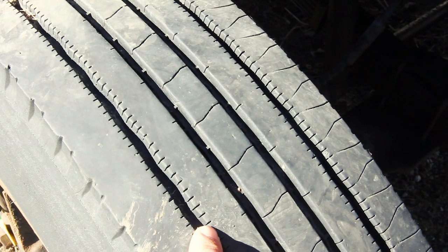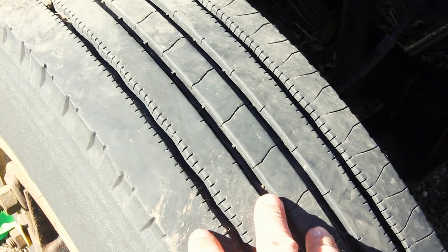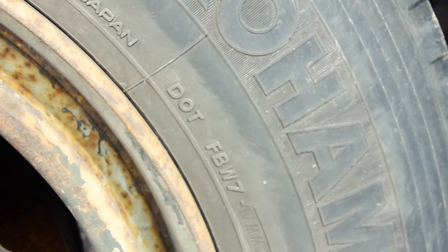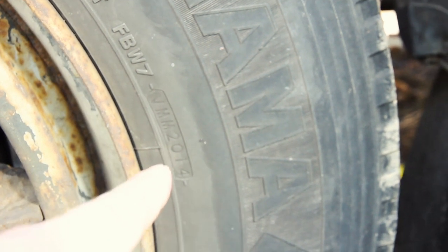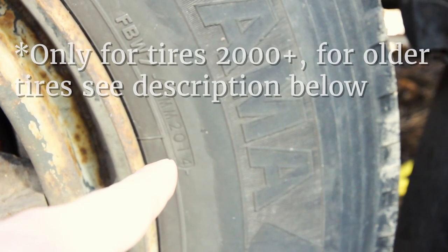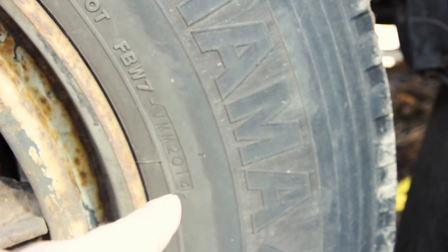Here are some extra tips if you're purchasing a school bus. A tire may have great tread but be very old — these tires, as well as those on RVs, are prone to dry rot. It's generally recommended they be replaced every 10 years regardless of tread depth. To find out how old your tires are, check the DOT tag. Look at the last four codes: the first two numbers are the week it was made, the last two are the year. For example, '2014' with '20' means the 20th week of 2014.